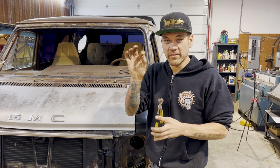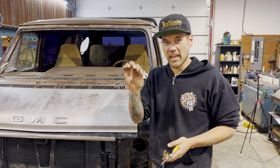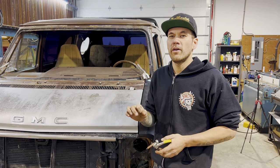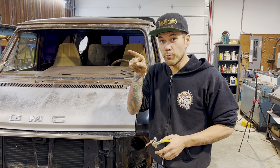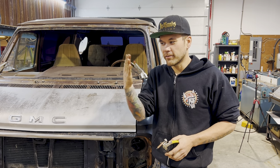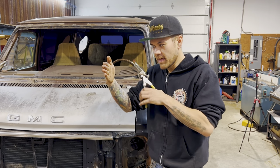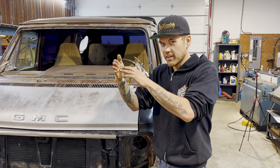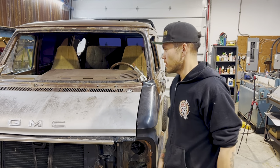Like I said, a 5/16 drill bit is what I'm gonna use when I'm MIG welding. It's nice to have a little bit larger hole so that the wire of the MIG welder can go through the hole and actually weld starting on the back panel. So you've got a panel and a hole to spot weld. I want to hit that panel on the back side so that it penetrates and locks it to the front panel. So that's what I'm gonna do now.